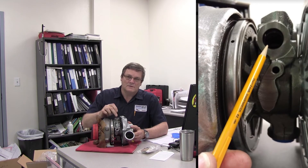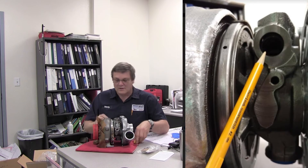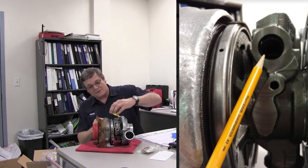Also, I just want to tell you — when you install these turbochargers, you want to put oil on top here. You want to fill this cavity up with oil before you start the vehicle or the engine.